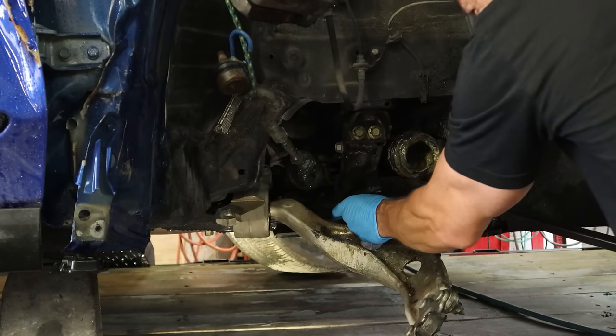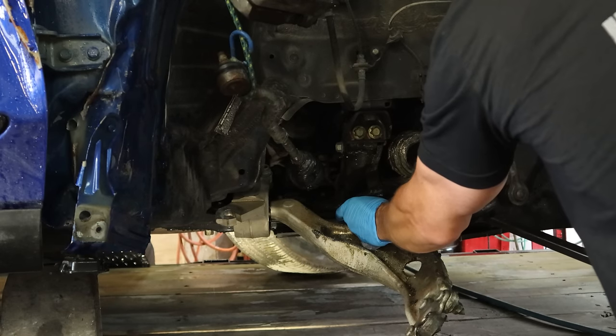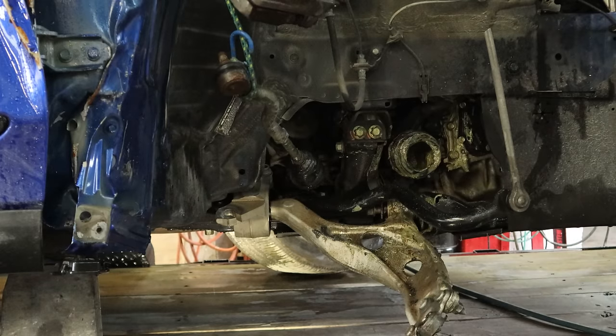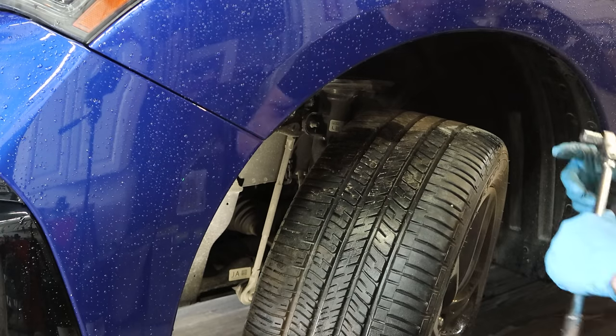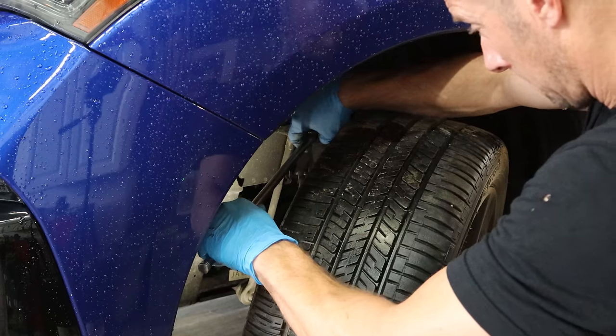We can unbolt our strut assembly — just leave the knuckle on it, no need to take it apart. Now we're going to jack it up a little bit so I can fit underneath. We had it sitting on a big block of wood when I transported it — I don't like them leaning, so I put those under there to keep it somewhat level when I tie it down. I'm not even going to use a jack stand. I'm going to unbolt our lower control arm. Put our control arm down a little bit so we can get to the bolt in the front, and our sway bar's in the way so we're going to pry it up a little bit so we can get the wrench in there. Then we'll loosen that bolt one eighth of a turn at a time.